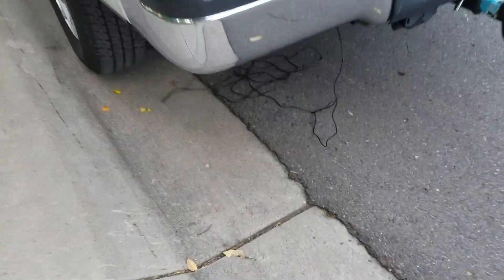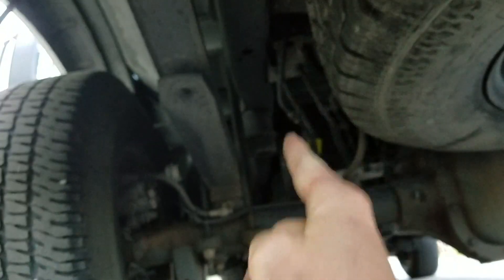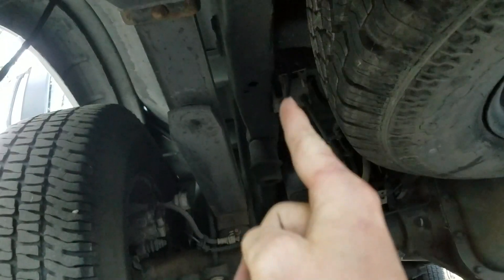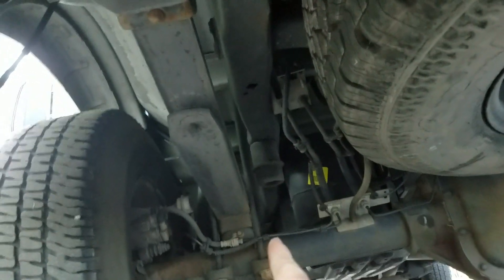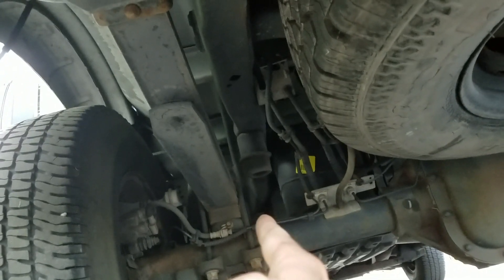For fishing the wire underneath the truck, I'm deciding to go right along this rail right under here. You can see there are wires already going all the way down it. So I'm going to zip tie it on those wires and just bring it all the way down until I get to the left side of the door.